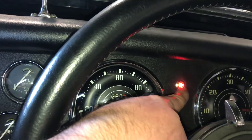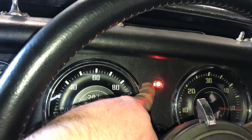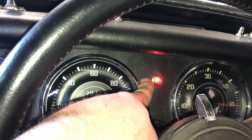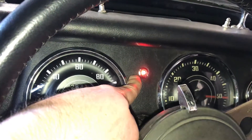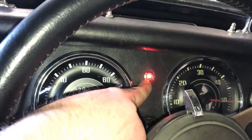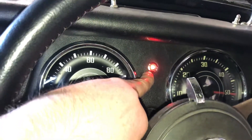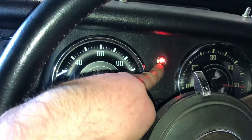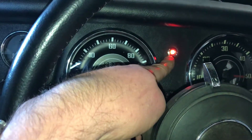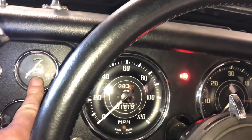In reverse, when I stop cranking and the oil pressure drops — which is what the warning light is for when I'm running or racing this car in the TR Registered Sprint and Hill Climb Championship — when the pressure drops to 20 pounds this light will come on. That's a warning that something is catastrophically wrong and I can turn the ignition off and coast to a safe halt.